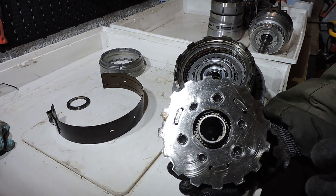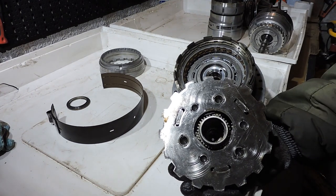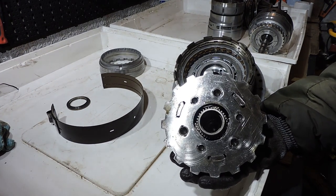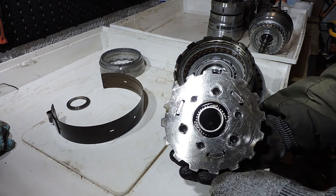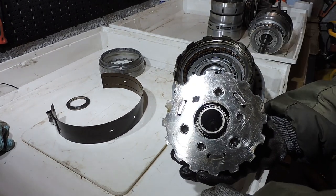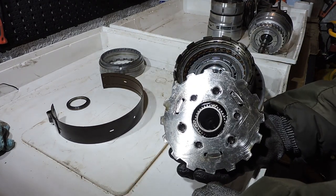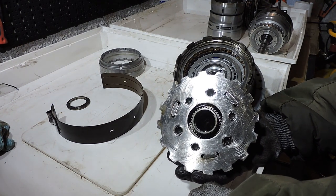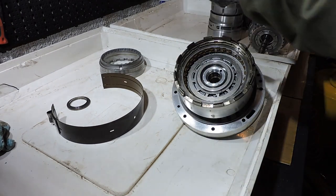When accelerating from zero, you increase torque at the output shaft of the gearbox but decrease output shaft speed, so you accelerate quickly but need to shift up. In the overdrive gear, you do exactly the opposite: you increase RPM at the output shaft but decrease torque from the input shaft, so outgoing torque is lower — which is why you can't really accelerate from an overdrive gear.